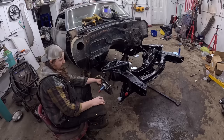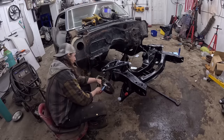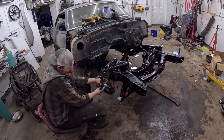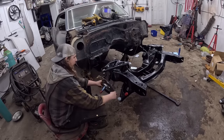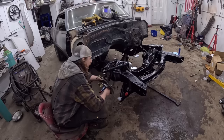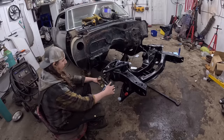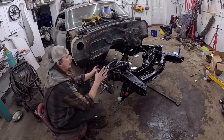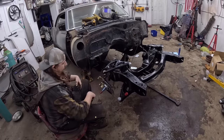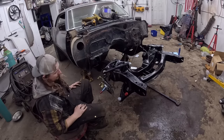Okay, I think that'll work like that. So now we'll just flip these around and put the nuts on the back side, to kind of align it and make sure it's good. Okay. Like building a brake sandwich. Okay, so there we go. That's all together. I'll run those down with some jam nuts that came in the kit. Actually, one I buggered, unfortunately. Then I'll come back. I'll get the rotor, I'll clean the bearings up and get them packed full of grease. Slide that on, the brake goes on, it's like a super slick kit. Very simple. I need some tools.